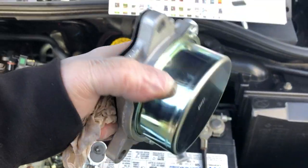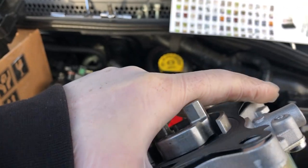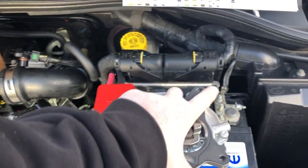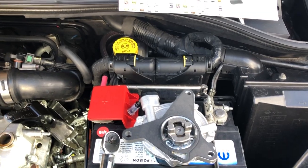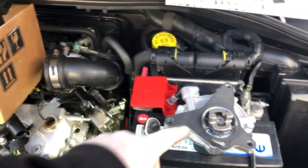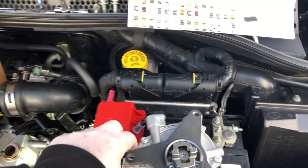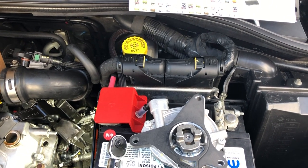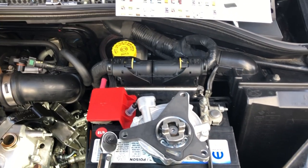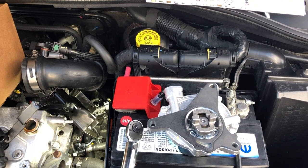This little part will obviously serve you well, but if it's leaking, I would suspect you've got a problem with the pump itself. A lot of times if this thing gets pulled off for some maintenance work on the engine, it will almost always leak if you put the same gasket back on. So I would encourage you — if you don't think you have a problem with your pump, just buy the gasket. It's about $22 and you can put that on there.